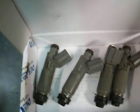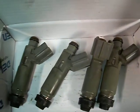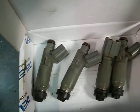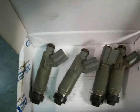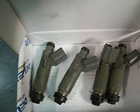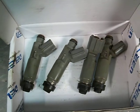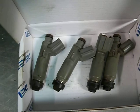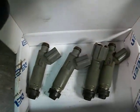But yeah, you can't really check it out until I find the source of this aluminum. So if it's the number 2 piston, I'll probably figure it out. That piston just got so hot it started expanding and shaving some metal out of it. If it's someplace else, we'll find out after the next video, I guess. So whatever I find, I'll try to document. This initially started out as a rattling sound, and could lead to something else. So hopefully I didn't buy all these parts for an engine that's ready to blow up.